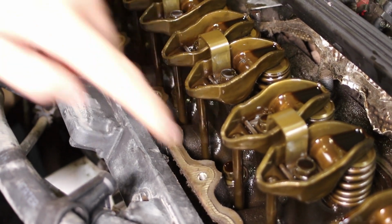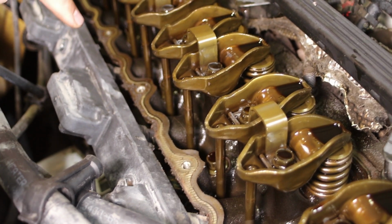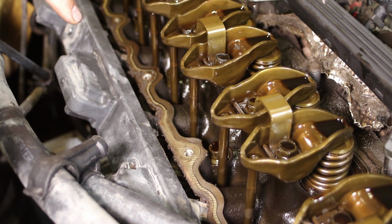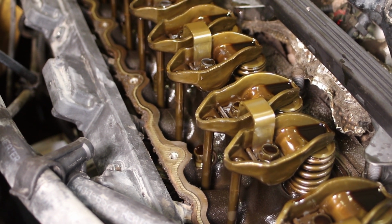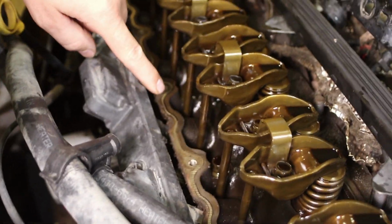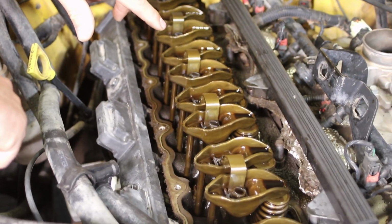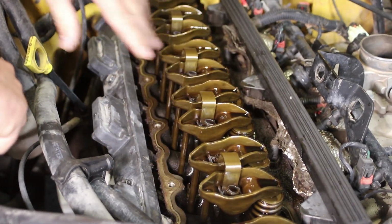First thing you want to do is use a cleaner around this edge, whatever you have around. If you have carburetor choke cleaner, you can use that. The brake cleaners are going to cut through quicker. One of the things we do recommend when we're doing this is an oil change after, especially if you're spraying cleaner into this area. The brake cleaners and stuff like that are going to evaporate, but it's always good to do an oil change once you've opened this up and you got it clean.